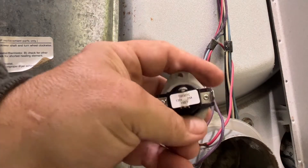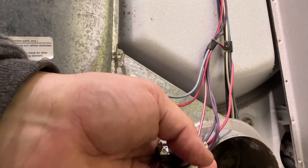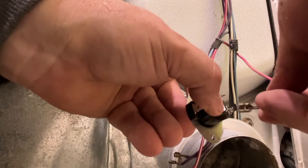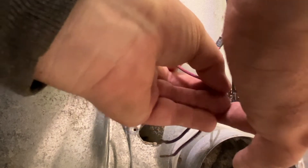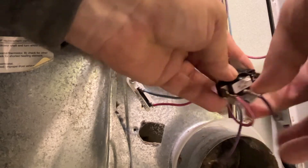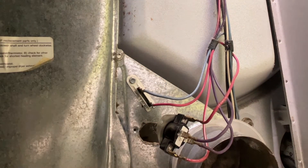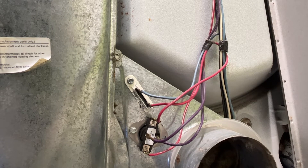As we saw, the new fuse tripped when the temperature got up to 155 degrees. Now I'm just going to hook it up — the purple wires are going to go on these two small poles and the two red wires are going to go on the outer poles. This one can only go on this one because it's the large male end, and then these will only fit on the small connectors. It's as simple as that to reattach, and now I just have to screw it back in.